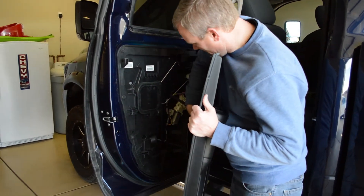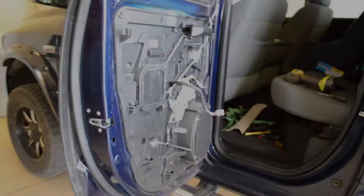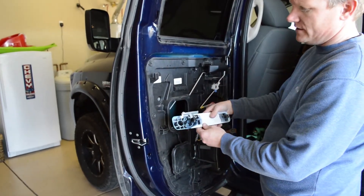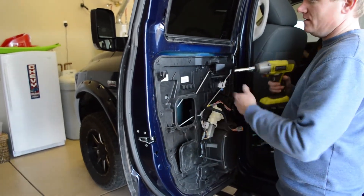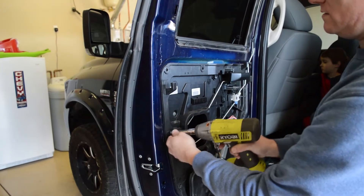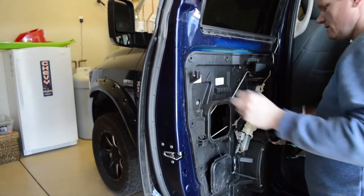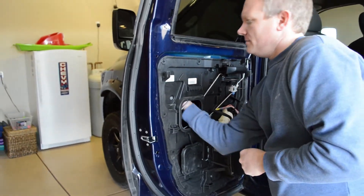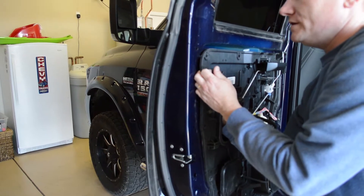Once you remove that, there's one plug behind here for the door window control. On the door, there's this little access panel that you can pull down and then be able to access the back side of this. Here are your connections where we'll have to unscrew the bolts. I like to take these three bolts out to allow easier access so we can kind of pull it up and see. Now I have a small wrench with the number eight millimeter that will get in there and be able to loosen it up. Peek in and feel around where that first bolt is to loosen it up.